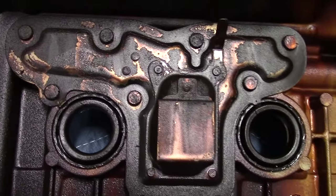Very important step here: the torquing of your valve cover bolts. The torque spec is specified in the beginning of the video and also in the video description below. Do NOT over-tighten these bolts — it may seem like a light torque spec, but trust me, these break very easily. They will break and then you will be mad at yourself, so make sure you use the proper torque setting. These will feel really light to torque, but Toyota engineers knew what they were doing — just follow the factory service manual torque spec and you will be okay.